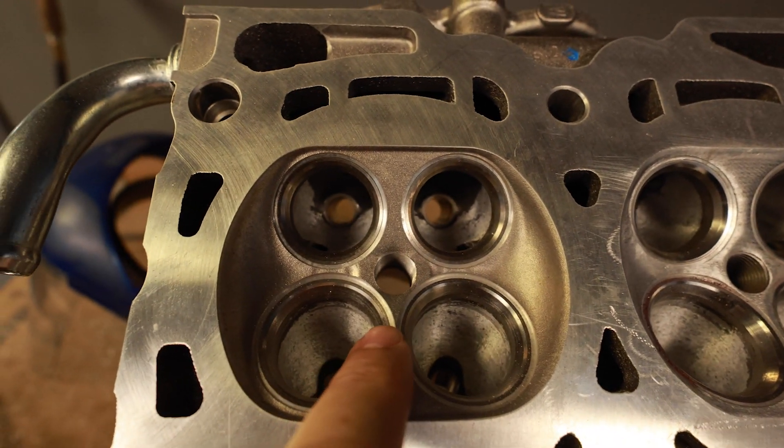This is not so much a how-to — I'm just going to put some music to it and show you what I normally do. Then we're going to get into the combustion chamber. We're not going to make it bigger, but this particular cylinder head is very timing sensitive to the tuner on the car. What we can offer is making it less timing sensitive by blending in all the hot spots in the chamber into the top cut. No other Subaru has this combustion chamber — it's only this casting. We're going to pocket port it, digitize the pocket port, and digitize the combustion chamber. You get our pocket port package — stock size GSC valve train, stock size valves, a Cometic spring kit with a GSC S1.